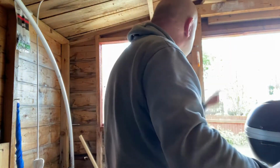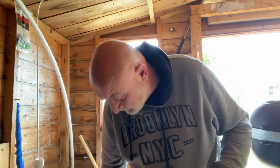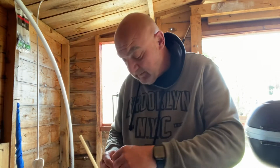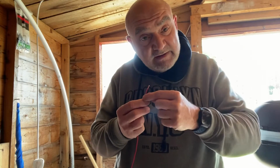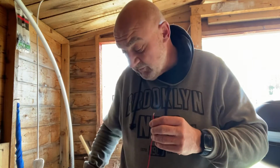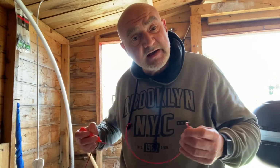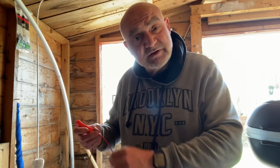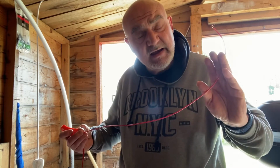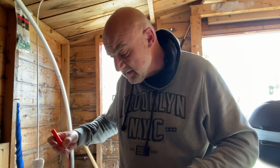So anyway, you just put a bullet on the ends of a positive and put that on the ends of the crocodile grip, pop it in, and then at the other end you can put the SAE lead and connect that to the bike. So it's dead easy to do, absolutely dead easy to do.